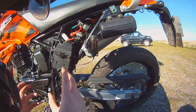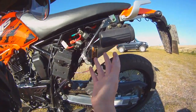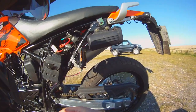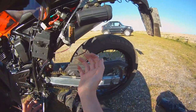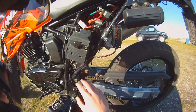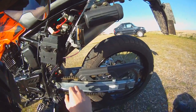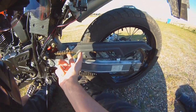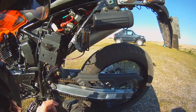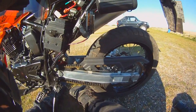It fits any bike — sports bikes, cruisers, supermotos. I was concerned about a supermoto being too bouncy for it, but they confirmed it's used on enduro and MX bikes with great results. I've had it on for a week now and I'm still playing with the flow rate a little to get it just right — it will vary per bike depending on how bumpy your roads are. If you look at my chain, it's wet with oil but not overly wet — just a nice lubrication. You don't want it too dry and you don't want it soaking, so you just have to dial it in.